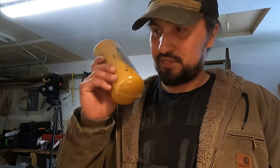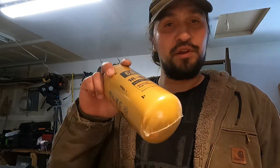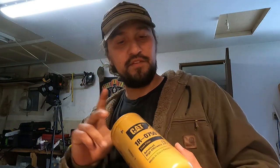So, what is the controversy behind these? Some people think they have a 10 micron rating or a 17 micron rating or something ridiculous. So they say just get an OEM, just get a Baldwin, an AC Delco, or a Napa brand and be done with it. That's fine. You can do that if you want to, 100% okay. But it's not a 10 or a 17 micron, as I just stated. The general consensus is a 2 micron rating at 98% efficiency and a 3 micron at 99% efficiency.